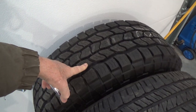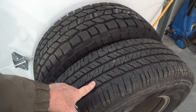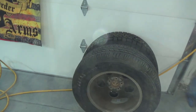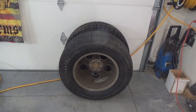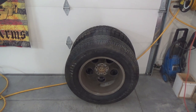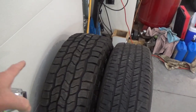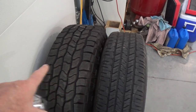Now, we've got a 285/70/17 on there currently. This one is a 255/70/18 — bigger rims, smaller tires. So that's why we're going to put them on there. That's going to make it lower by about a half inch. I know I'm going totally opposite of what everybody else will be going, but sometimes you go back so you can go forward. Like I said, we'll use those tires when we're done towing this around the nation this summer. We'll stick them on when we go up in the mountains, but it ain't that hard to just change them with all my tools.